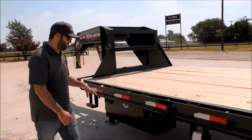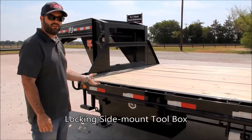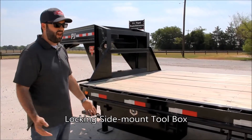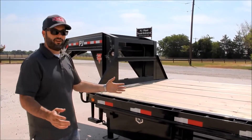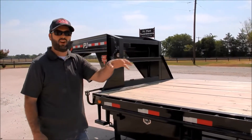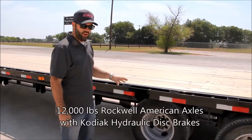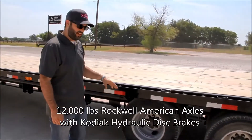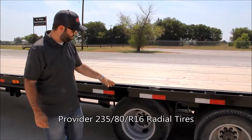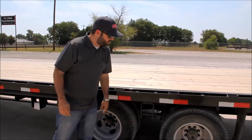This trailer has also been ordered with a side mount front toolbox. If you're going to be in the hotshot business, you need lots of storage — this is the way to go. Other options people might want to add include a wood rack to carry four-by-four posts. Now for the running gear: this trailer is equipped with 12K Rockwell axles, Kodiak hydraulic disc brakes, and Provider 235/80 R16 tires. The winch ratchet is welded between the wheels on this trailer.